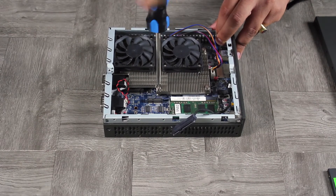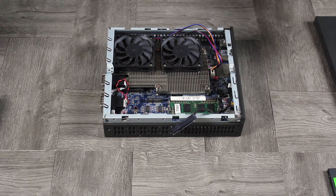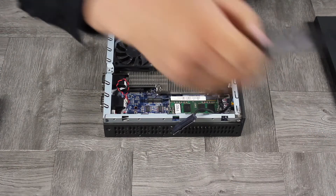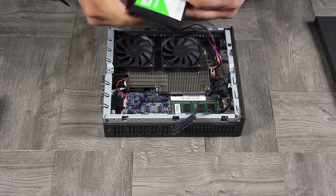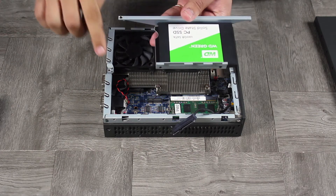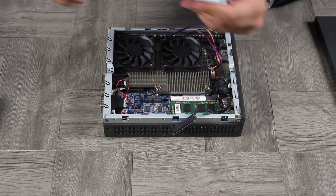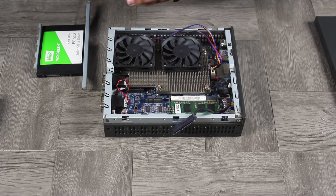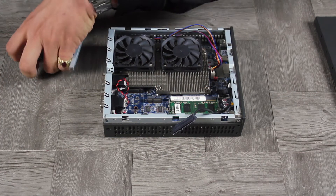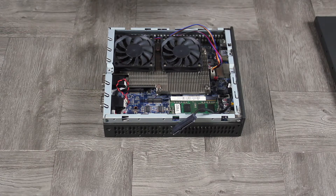It has to be snug — it doesn't have to be water tight, just snug. You're almost home free. Next step is hard drive installation. If you're using a 2.5 inch drive, line the SATA connectors to the side opposite the screw hole. There are four screws in total. For an SSD you can get away with one or two screws since there are no moving parts. If you're using a mechanical drive with spinning platters, I recommend using all four screws.